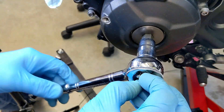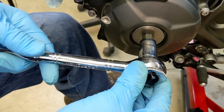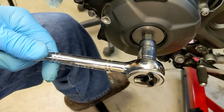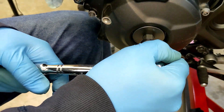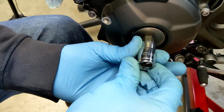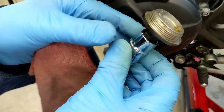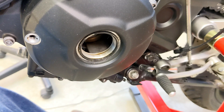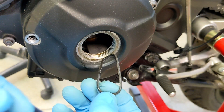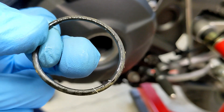I'm going to rotate this down so I can get a good angle at it. I wish I just had a regular 14 because there's a lot of slop in this socket — it's hanging way out. On my Suzuki I actually stripped this out, so I'm pushing in really hard with my right hand to keep everything tight. That was way easier than I expected — I was anticipating a huge battle. There's a little O-ring right here; I tried my fingernail first instead of a sharp tool so I didn't scratch anything, because if you scratch it, it won't seal properly.